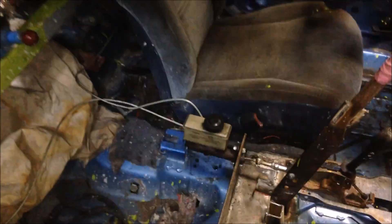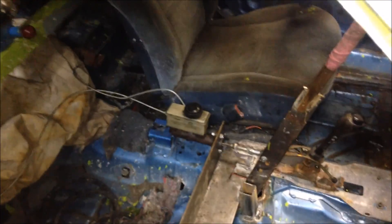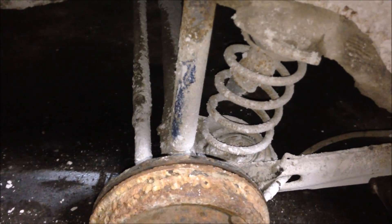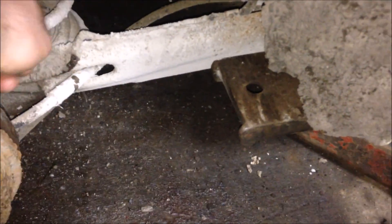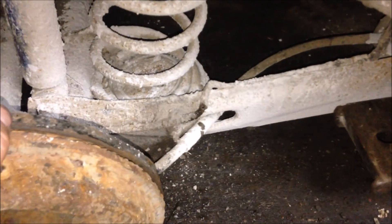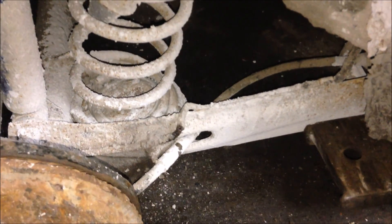The car still runs and drives. I've got it braced to the floor — I'll probably do this a lot better once I make sure it works. Hopefully that right there solves Cassandra's problem with the non-locking rear brakes. The other option would be to swap in a Cavalier rear axle, but I don't want to do that because this rear axle looks more solid. And look at that — a leaky brake line. So there's the first glitch in the plan; more brake lines to deal with.